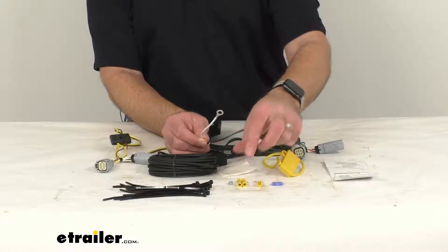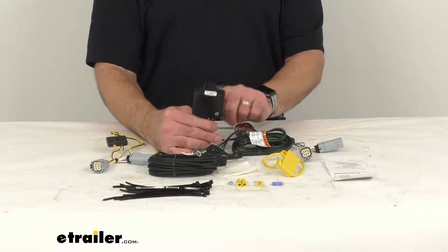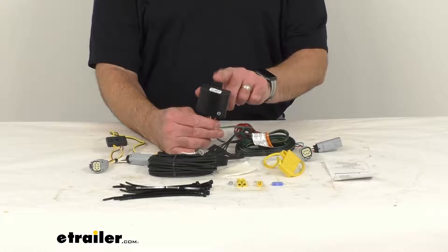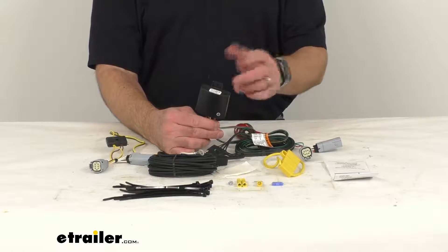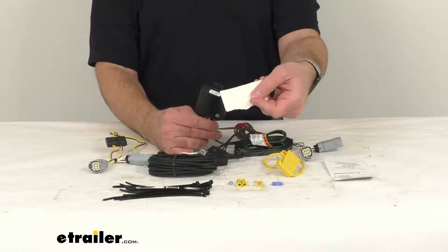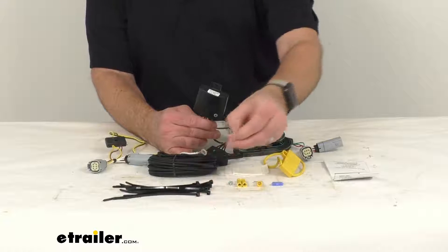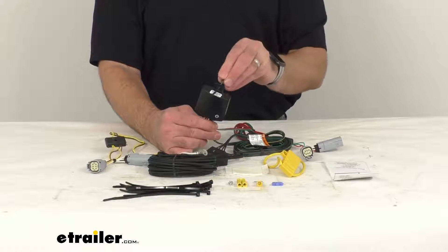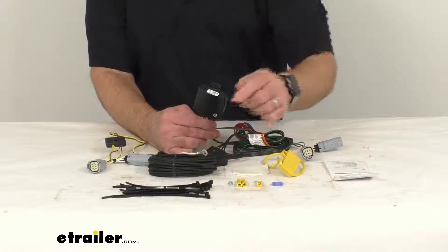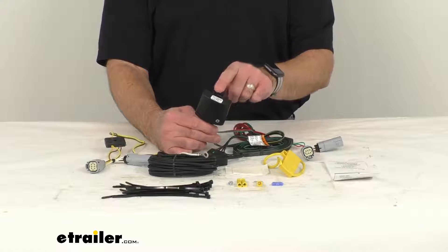Once you find a suitable location such as your vehicle's frame or crossmember, you can use this screw and secure that ring terminal there for a good ground. Just make sure that the surface is clean and rust-free. Then you would need to mount your converter box to a safe, out-of-the-way location. You can use another mounting screw, the included double-sided adhesive tape, or even one of the cable ties — run it through the top hole of that Modulite converter box to keep it secure and out of the way.